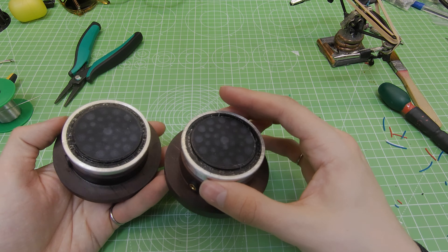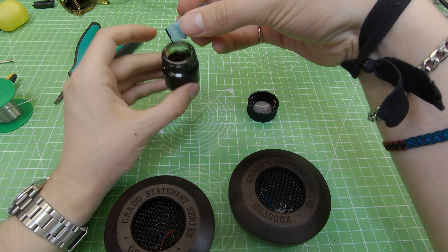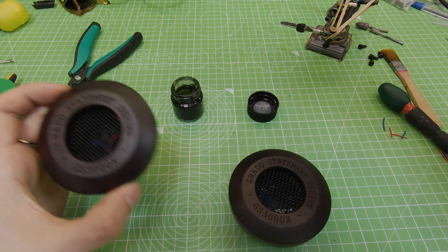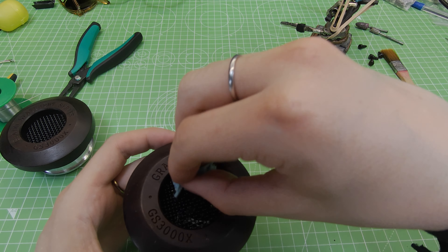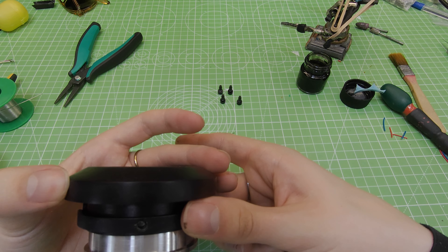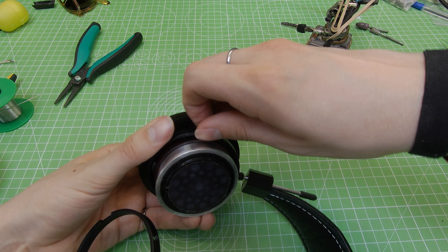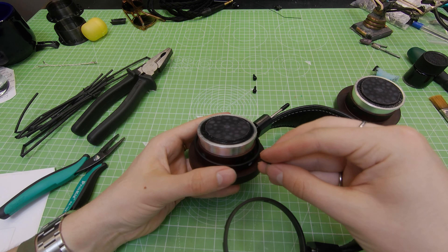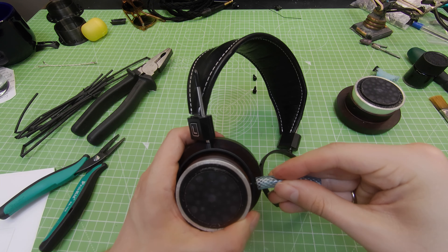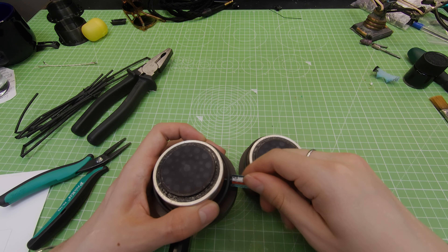So this is a thing that we like to do on the Grados with the grills. I'm just dipping a little sponge into some black modeling paint, because these grills are black painted and they often get scuffed and beaten up a little bit. You can just see the metal underneath, and it's nice to dab this on just to make it look as good as new. So all the electricals are done, all the cups looking good, so now it's time to secure them back into the headband. I put these little grub screws back in, and we tighten them with this little bit of hose that we have, just because they're also painted.